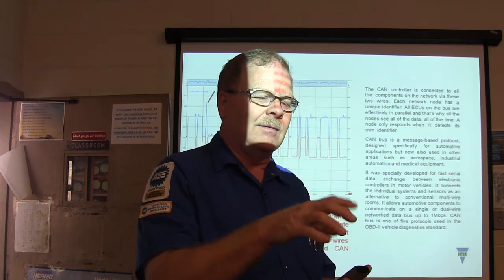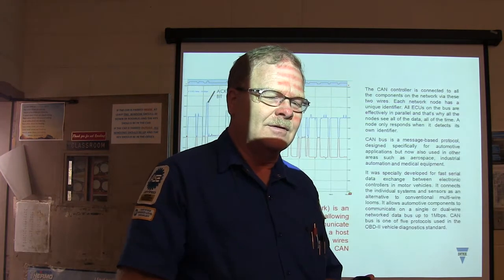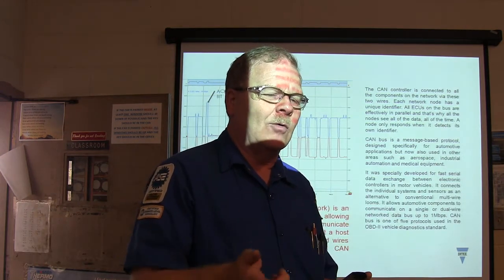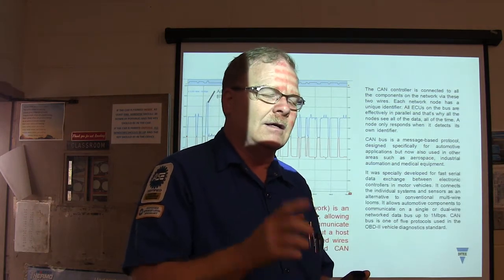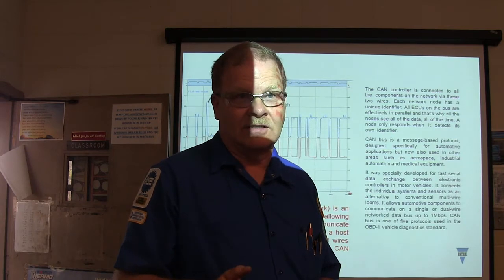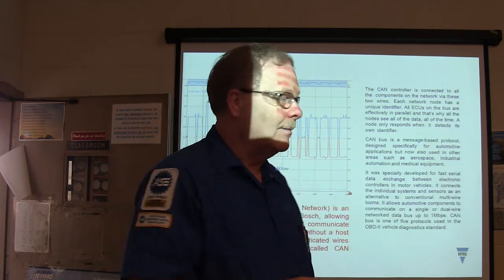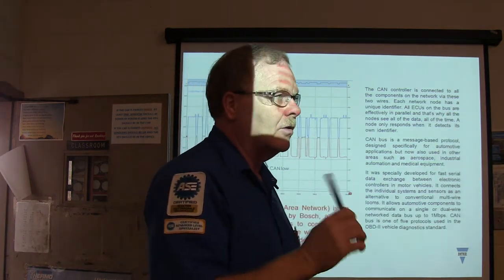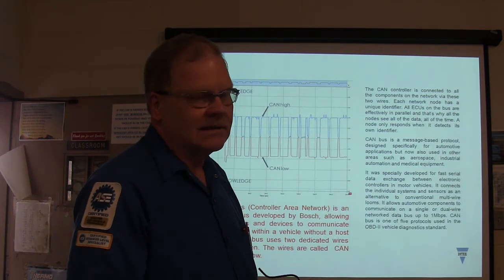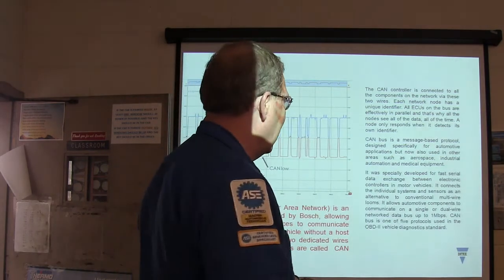And that little turbocharger device was talking over a CANBUS to the PCM, and the PCM would request a particular turbo angle, and this little thing would say, I'm not doing anything until you send me some coolant over here, because I'm hot. You know what I mean? So it had to be kept cool and all that. But the CANBUS lets that stuff talk really fast, and there are 2 or 3 different speeds of CANBUSes. You know, there's high-speed CAN and low-speed CAN.